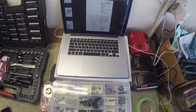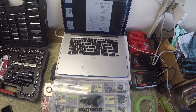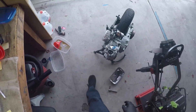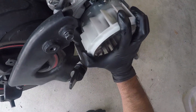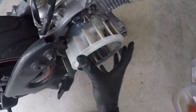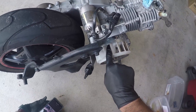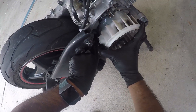Okay, align mark A on the AC magneto rotor with the stationary pointer B on the crankcase. So mark A — there's mark A. There's a mark T-F on the magneto wheel, and there's a mark on the inside of the crankcase — the little arrow right here — so I'm going to line that up.